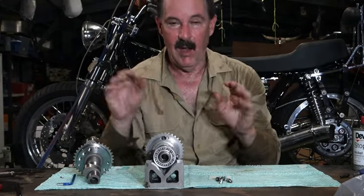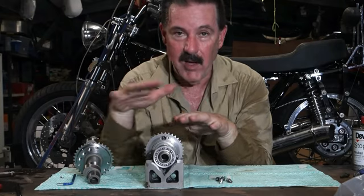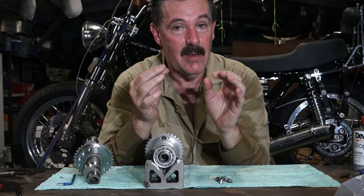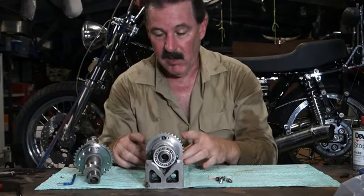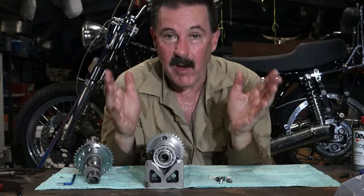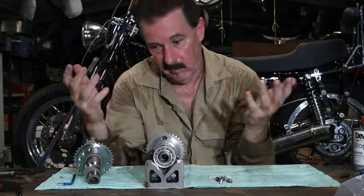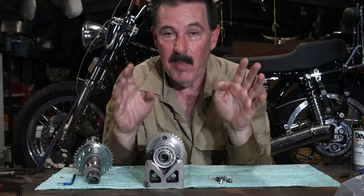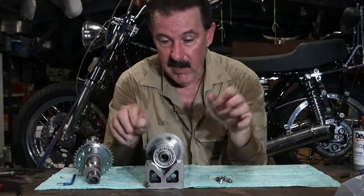Right? That means piston skirts shaved if that's what you wanted to do. Crowns modified if you had to, and by the way, I did. Rings gapped, so that everything weighs what it's going to weigh going into the motor. So I gave him all the parts in that condition, and believe it or not, he said very little work had to be done, which is great, saves me money. The more time he spends on it, the more it costs. But as it was very close to being perfectly balanced anyway. But anyway, that done, right, we now have this.